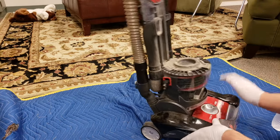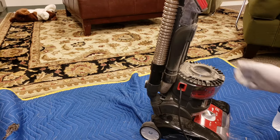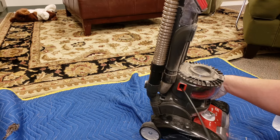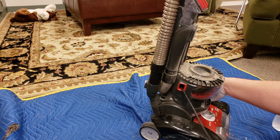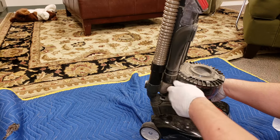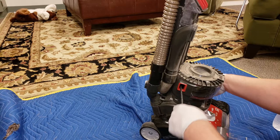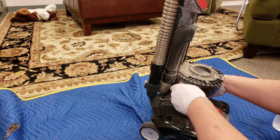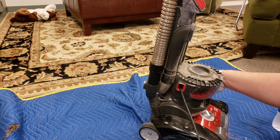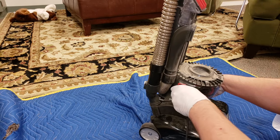Let's see if the cord rewinder works. Just pull it out a little bit. It's pretty slow. So this is how you fix them, as you pull them pretty far. It's a little slow with running. So you hold this down and you just pull. And you just pull. So it's getting better. It's gonna take a little bit of this. But we will. Make sure the spring is better. So let's put it back in fully. Yeah, it's getting better. Takes some work, but we can get that fixed.